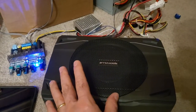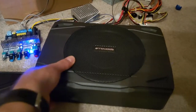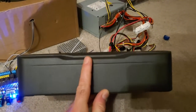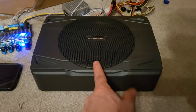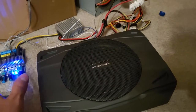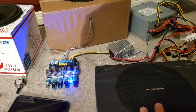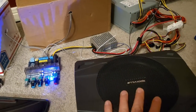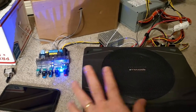I wanted something very, very small — this is crazy small, less than three inches in depth. So this is going to fit right behind the seat perfectly. We're just going to hook this up. It'll make it so that the 100-watt channel doesn't really have to produce 100 watts, because it's basically going to be line level as opposed to speaker level, and that'll make it run a little bit cooler. So all this kind of goes together.